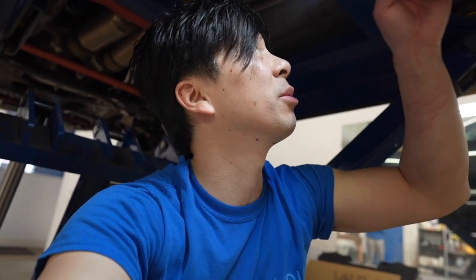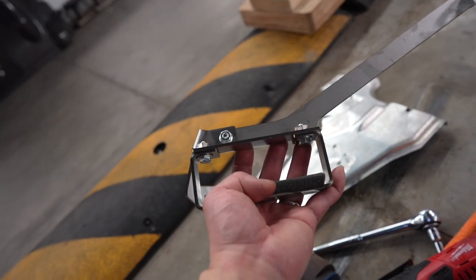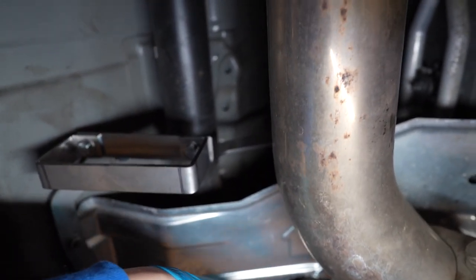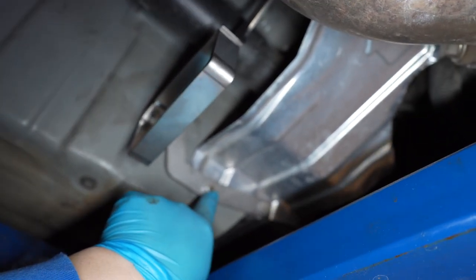Got her done! That install was a tough one. If you guys can take that cross member off it would have been a lot easier, but I didn't have a choice. I had to take the heat shield off to get the hoses in, then reinstalled the bracket. The heat shield is back in, trimmed and rounded off, and the bracket and hoses are in. I reused the factory nuts here, same as the one up top.